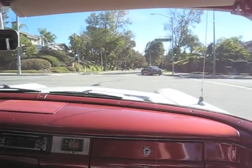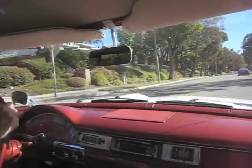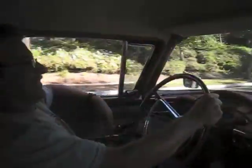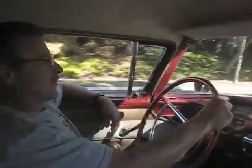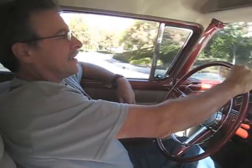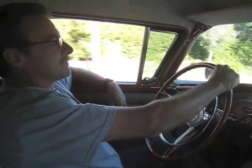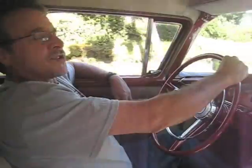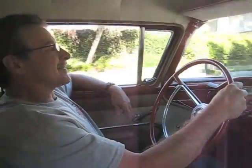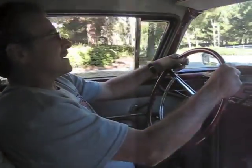Professor Toothman is taking it for a ride. We're not getting any burpage through the carburetor, which is good, but do you feel that sluggishness? There's a little flat spot kind of off-idle there. It really wants some fuel, doesn't it? It needs a little bit of gas. We should give her a dose and see how it responds. You know what it feels like? Yeah, let's head on back and toss it in.